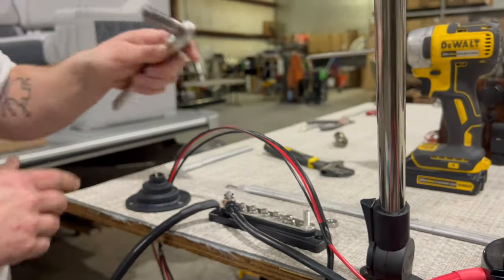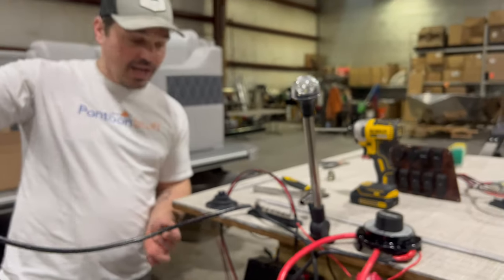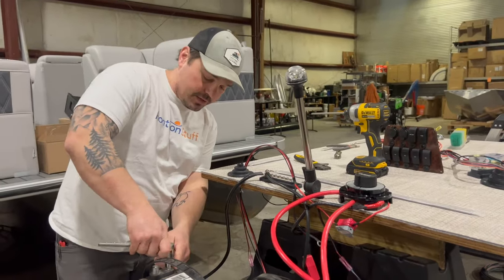I'm going to take one of those big ground wires that comes with the switch — there's a larger hole in one versus the other. We're going to take the smaller hole — that's going to go over the bus bar. Then on this same bus bar, since it's going to my starting battery, I'm going to run from my battery cables for the motor — run that ground on top of that post. They're both big heavy gauge wires, so I'm not too worried about the connection dropping. I've got the battery cable coming first, then the engine cable. Snug that down with a half inch socket, and then I can connect the other side of this to my starting battery.